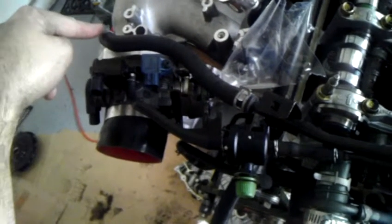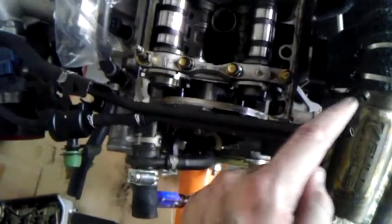I'm sure the wiring harness is going to have to move. The exhaust gas recirculation solenoid line here, which I'm going to be using — unfortunately, the wire on this for the boost controller, I believe there's only one that can handle or drive a solenoid, one wire on the K-Pro. So I'm probably just going to take this off altogether. I'm going to run a little catch can on the valve cover.